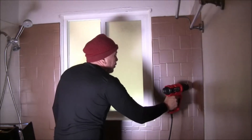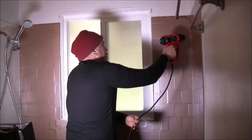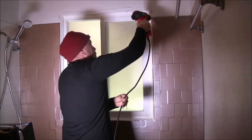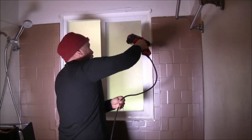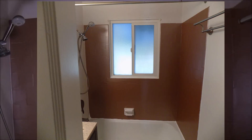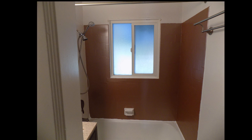The last part is to post-heat the film. We are applying high heat — around 220 degrees — against the film. This locks the adhesive in place to make sure the film doesn't lift over time around the corners. This is an industrial heat gun, not a regular hair dryer — you can get one at Harbor Freight for about 40 dollars. And that's the end of the process.